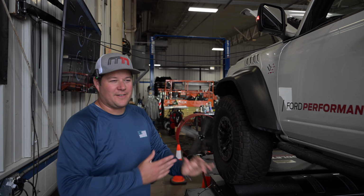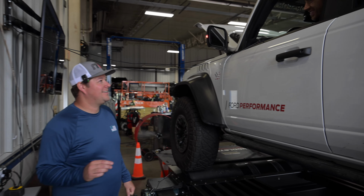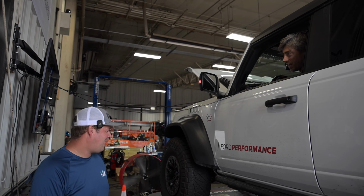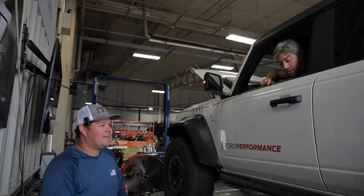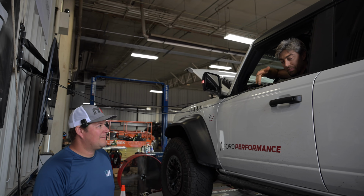All right, guys, we're back after lunch. I still think that we're going to get 30 wheel. Are you still at 20? I'm still at 20. So we're gonna turn the load cell up a little more, get the turbos to light a little better, because we were down on the two-wheel drive run before, because the dyno wasn't loaded as hard as four-wheel drive, we were down like almost a pound of boost.